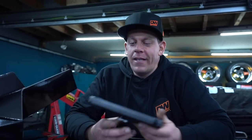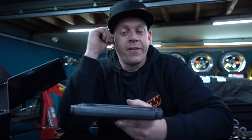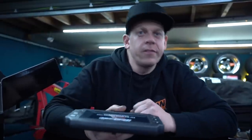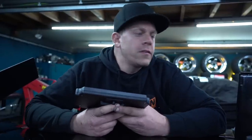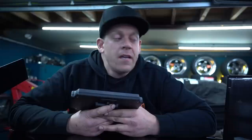Stuff from the late 80s, early 90s — this is a late 80s/early 90s car. It was an engine conversion but still had the original wiring loom, which has always been a worry. It's the original R32 body loom converted for the JZ conversion, then adapted for the Syvecs, then further adapted when we ran fans to the back. In the 2017 revamp, Simon and I took all the loom out, minimised it as best we could — it was a complete bird's nest — wrapped it all up and hoped we wouldn't have to see it again. We've been really lucky with no wiring faults, but it's always a massive worry before qualifying.